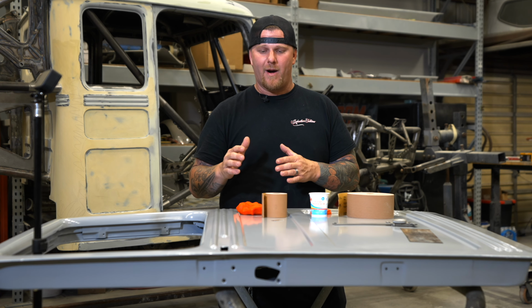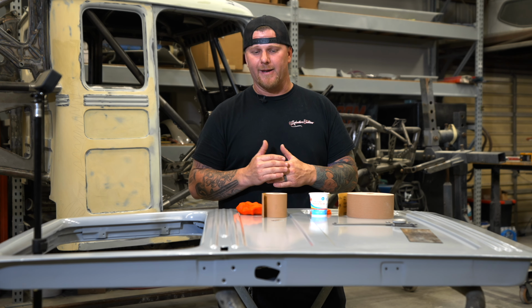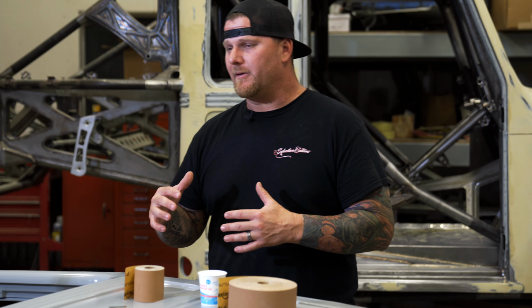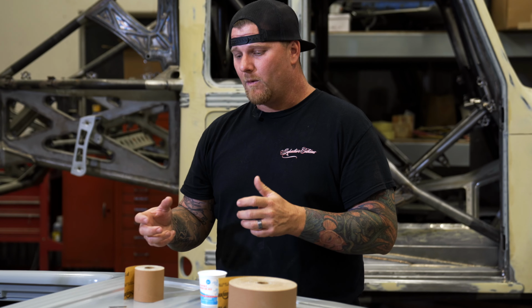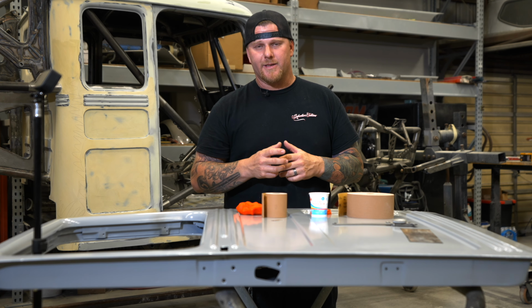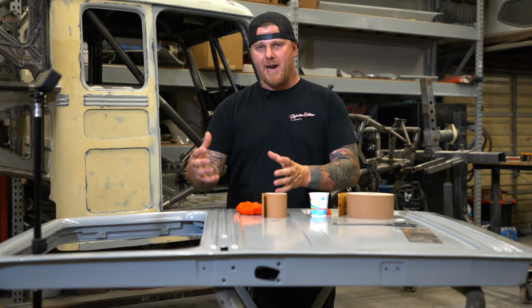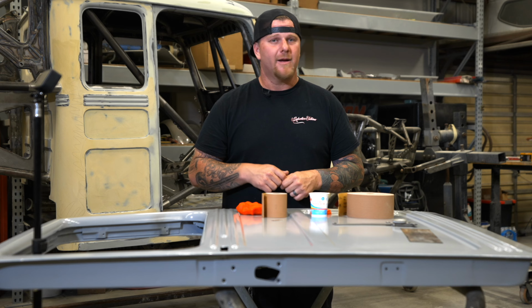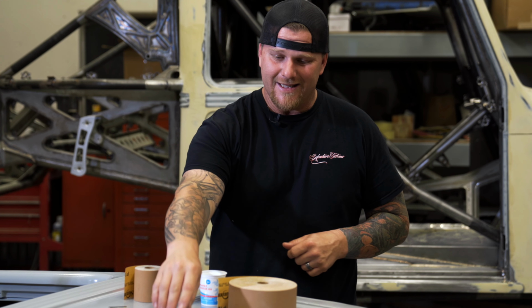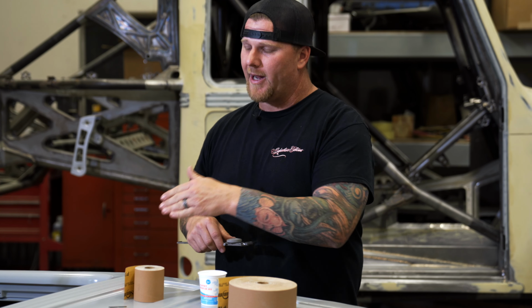And I wanted to make this mold after it was already primed, so we had a little bit more leeway. In the past times that we've done details on, say, an edge of a Cadillac fender where we had to make a mold, the problem was, when we would get everything flat and roughed in just like the Willys is, we would make a mold, we would put the sandpaper into the mold, and when we would block it, we would end up with the grooves on the outside. So the thought here was, let's take some calipers and measure what grit we want to use.